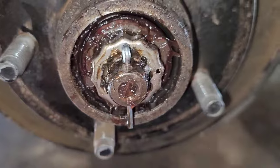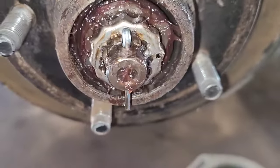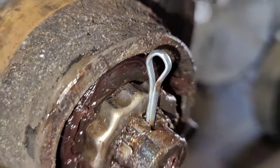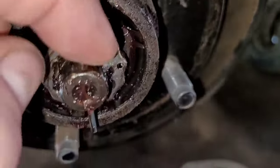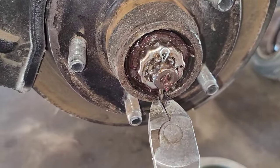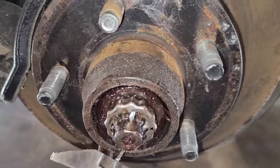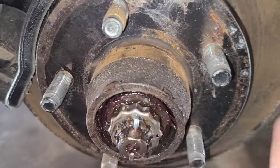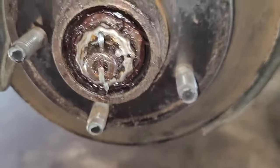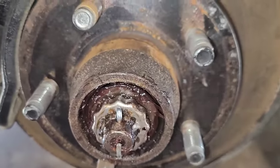Some people spread them this way and that way — that's fine. You want to do it this way and spread it this way, that's fine too. It all depends on the application and the style of the cotter pin. Like this one, it bows out on both sides; some are flat on one side. I always trim off that little leg that hangs down so it doesn't hit the cap — I've actually seen it slice open the cap.